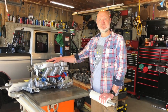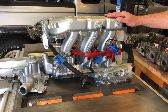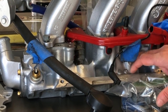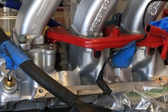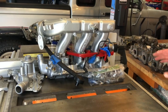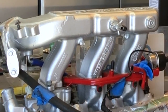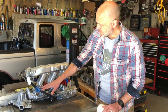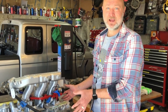That's given me time to do a few special things on the rest of the engine. Here is the intake for the engine — all this is original. I've repainted the aluminum parts, cleaned up the fuel rail, cleaned all the fuel injectors, and pressurized and pulsed them to make sure they all worked and put out consistent volume with one another. They're the original injectors and they cleaned and tested just fine. I also tried my hand at porting and polishing the lower and upper aluminum intake with a pneumatic grinder — matching all the ports and removing significant material to increase airflow. I'm guessing that's going to be worth maybe 15 to 25 horsepower, if not more.